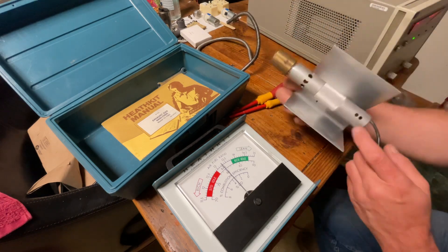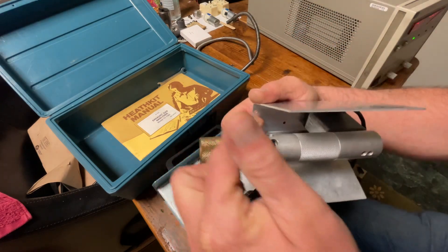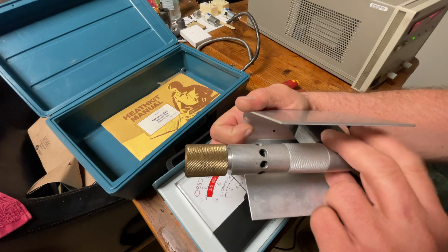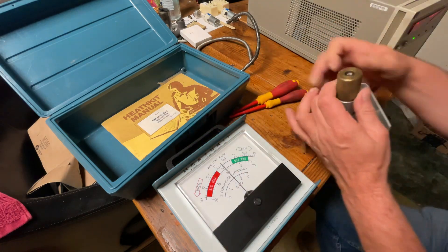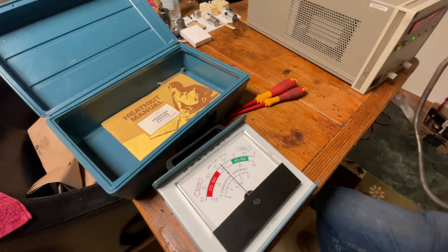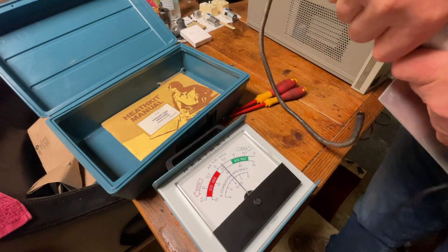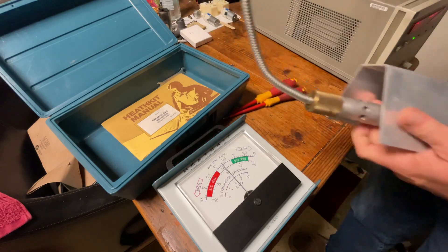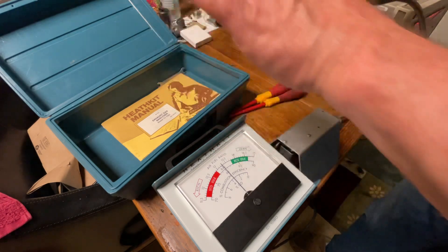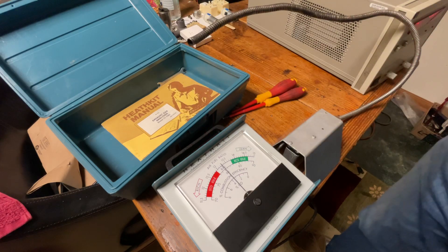Now what happens is this thing has two sensors in it — two NTCs basically. One has a hole, and the pipe comes in from here and blows the exhaust gas in. The other one is closed off on the other side, so it warms up unevenly, and it is that differential we are measuring. All you do is take this pipe, open this up, and insert it here like this and lock it in. You set this next to the muffler so this end goes into the muffler, with the unit underneath and the exhaust gas blowing out.